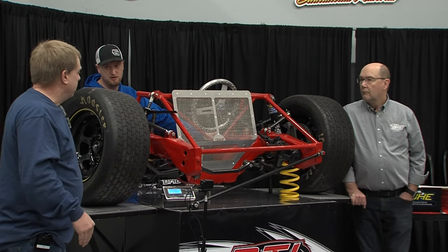When the track slows down a second and a half, the weight transfer we talked about isn't there. You can soften springs or just get the right front down into the racetrack — right front down, right rear down — to make side bite. The car will steer and make side bite on the right rear tire. Whatever you can do, Bob stresses this all the time: what can I do in my race car to go through turn two faster? Is it a little tight or a little loose? Because if you go faster through turn two, your miles per hour multiplies off the corner — two or three miles per hour through the corner is four, five, or six miles per hour down the straightaway. You can't pass somebody going six miles per hour faster than you.